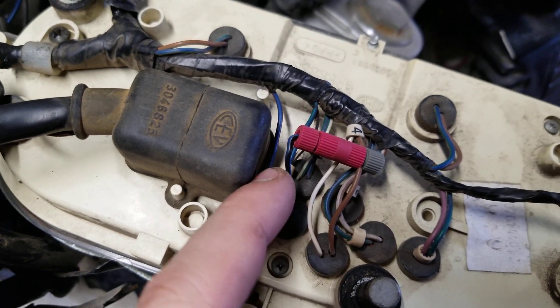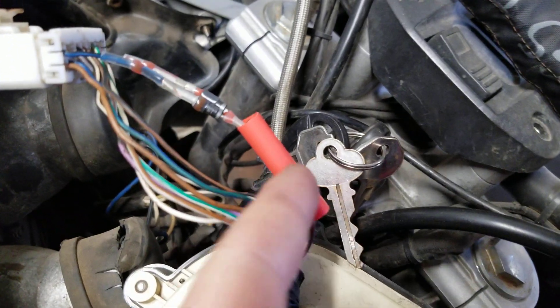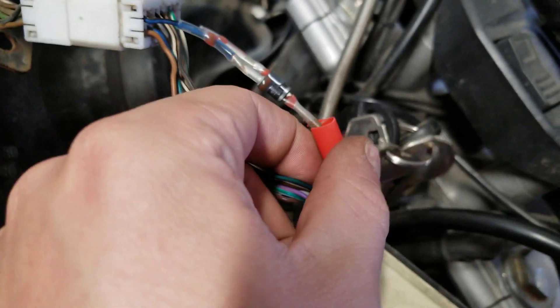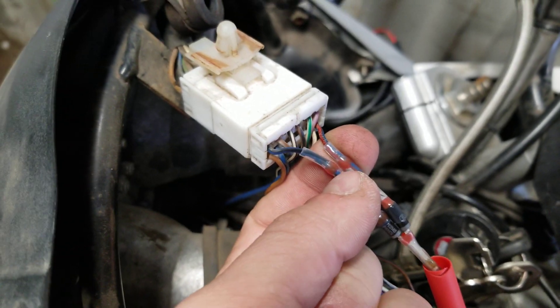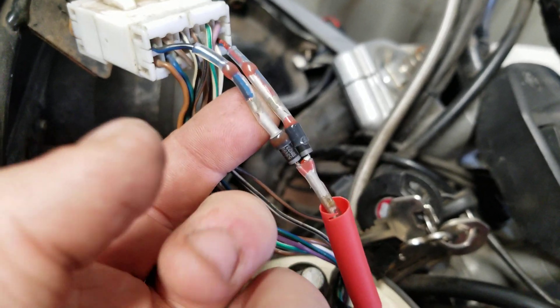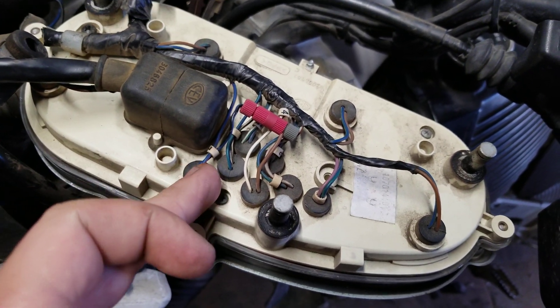I chose the blue and black side because black is kind of like negative, right? And the blue and red side goes up and we go into one side of a pair of diodes. Now these two diodes are teed into this wire — so we've got one wire in, two diodes out. We take the two wires from the harness and run those into one each of the diodes — one wire going into one diode, one wire going into one diode. Both of them are grounding out through the bulb.